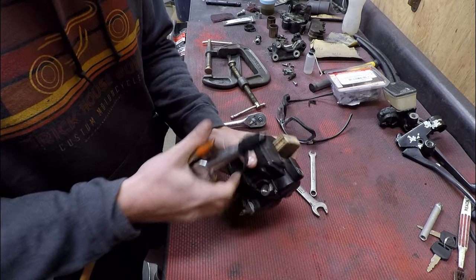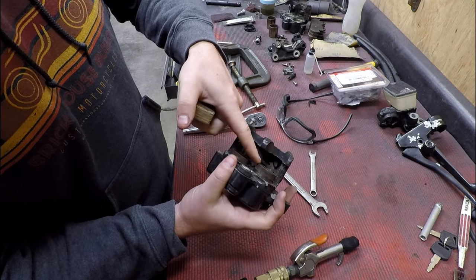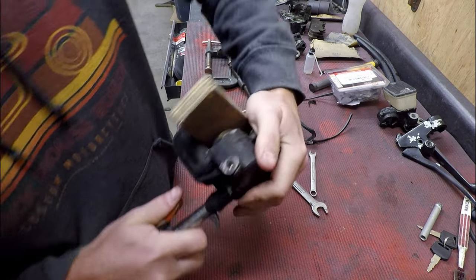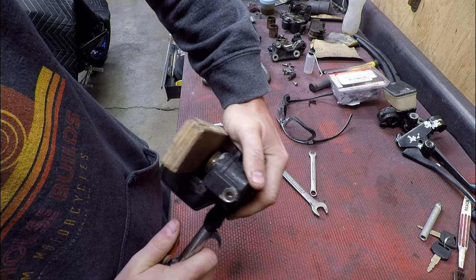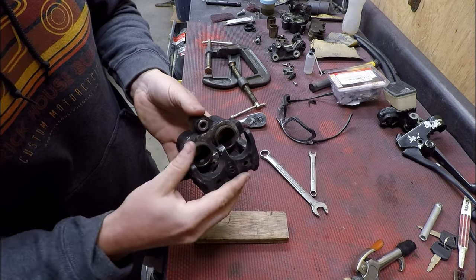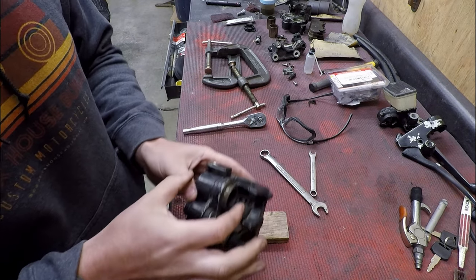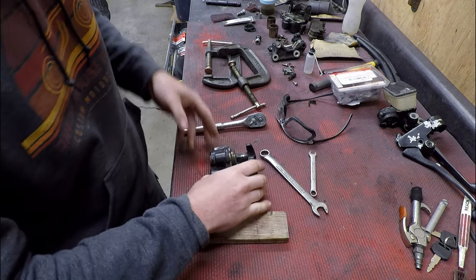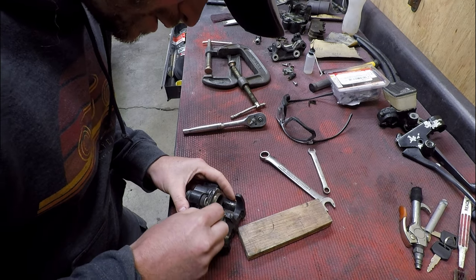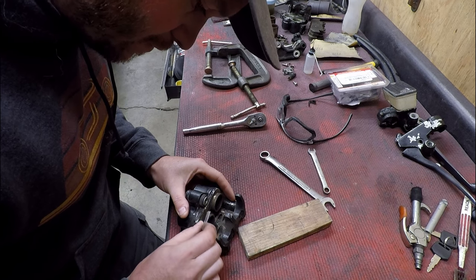So what you want to do is have some kind of a stopper, and this is going to give us an idea of how firm these things are in here. I've got the compressor aired all the way up — we're going to see if these things move. You can tell there's definitely slack in here. Alright, this one moved out a little bit, so that's good. I'm going to keep putting a little bit of air to it and see if we can get this other one loose. I can see it initially wants to move, so I think I'm going to clean the outside here, and then we can compress it, force it in, and then try to slide it again using air. Just take a little razor blade and scrape around it to get some of that corrosion off of there, so it's easier to push past any of the seals.